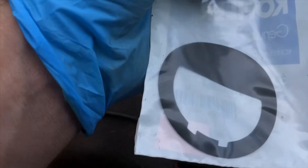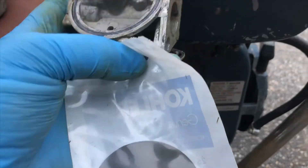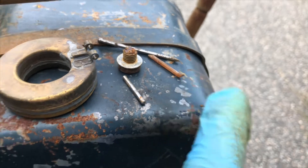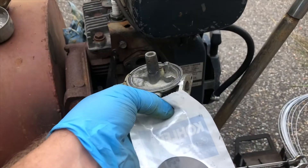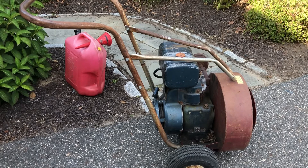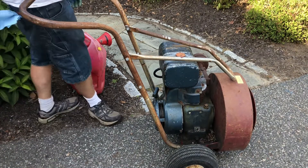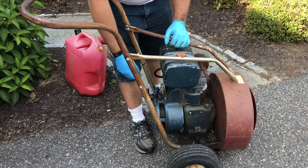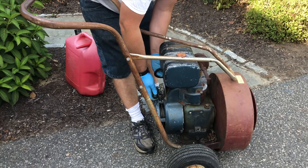I decided to use the original carb and not the parts carb — we'll just clean it up as good as we can and steal the float out of the parts carb and leave everything else OEM from the original carb. New gasket there, we've got the new float gasket — these are OEM parts. Interesting enough, the parts carb had a plastic pin in it on the float and we're not going to use that. So let's put it back together and see if it'll run. Carburetor is all cleaned out. I still don't have a throttle cable, but put the choke on and let's see if we can get some running.